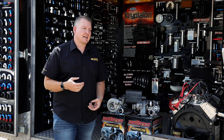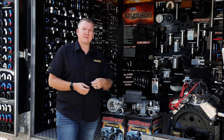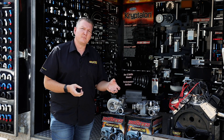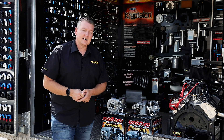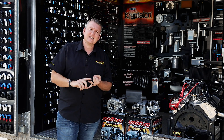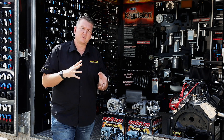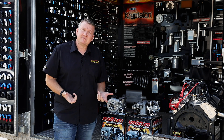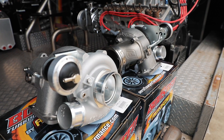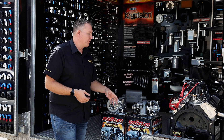We've been looking at where the holes are in our Boosted lineup. We've got the smaller ones — the 4628, the 5428, the 4849 internal wastegate turbochargers on the smaller side, bolt-on for SR20s and similar. Then we jump up to the Falcon or Barra direct bolt-ons — the 5862, 6662, and 6762 — and there's a gap in that mid 600-horsepower range. We decided to make one rather than adopt something already on the market, and we figured the 5455 is the best compromise.